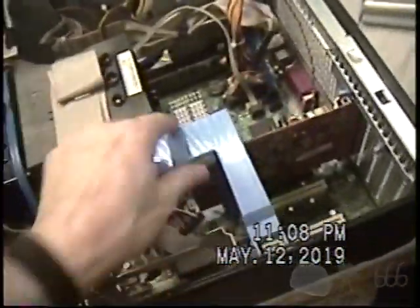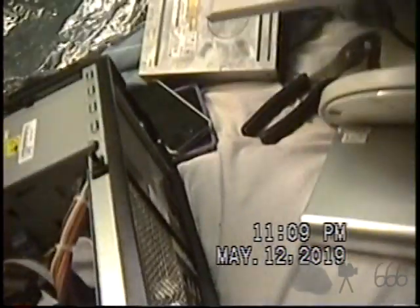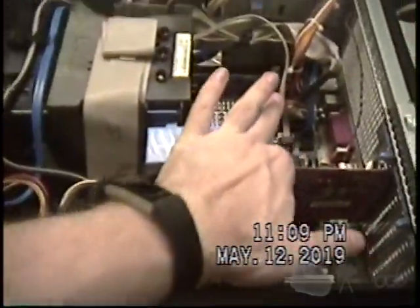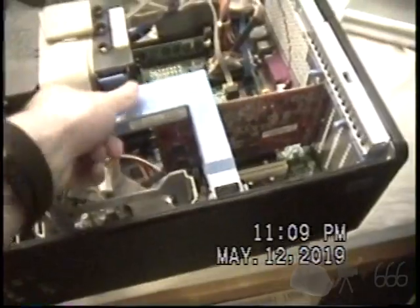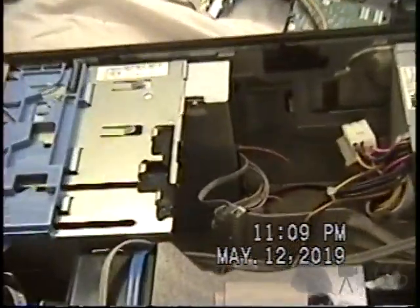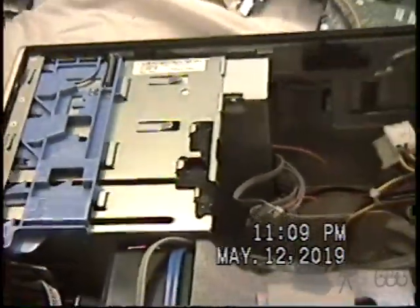This thing keeps falling. We'll just leave it alone. Yeah, if we look at the back, no. Oh yeah, no, there it is. PS2, parallel, serial. Looks like 4 USB, maybe 6 USB. Ethernet, sound. There's the power supply up there. No onboard video, so you need to have the video card, which doesn't really sit in there very nicely, despite having a lock. Evidently that doesn't work. This one's got a parallel ATA optical drive, which is interesting.